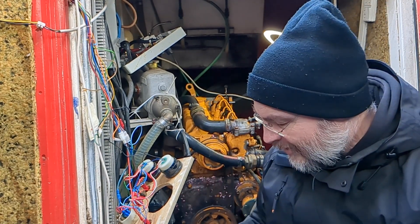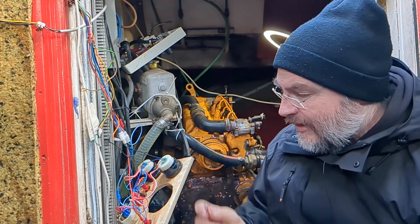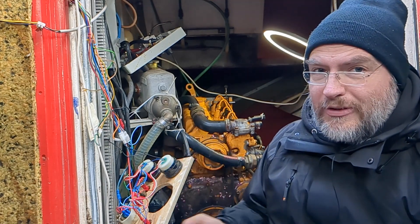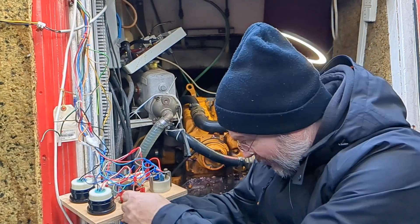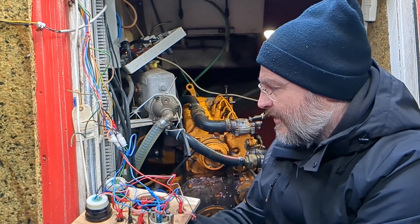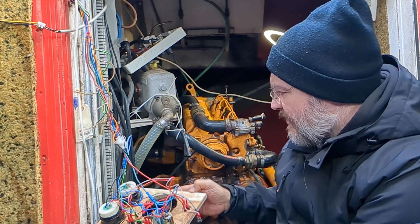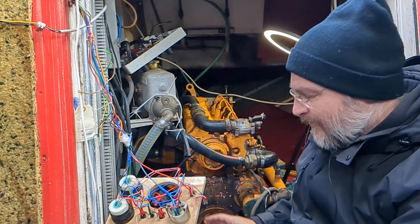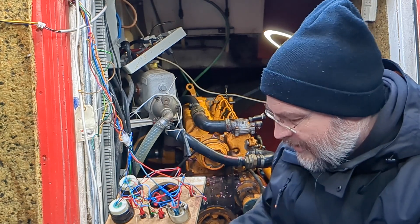So I decided to make a bypass cable — well, I have made a bypass cable. I made it quite a while ago for something completely different, but it turns out it might be quite handy now. I'm going to provide the solenoid with 12 volts directly from the system and see how it works. If it retracts as it should, well then it should work when it's in place in the engine as well. I'll take off the connector for the solenoid and feed into the exact same connection, with a separate ground connection because I might not get a good enough connection via the engine with all the oxides and paint everywhere.